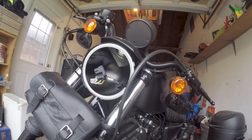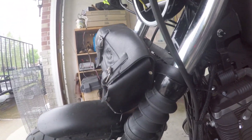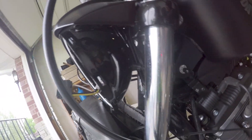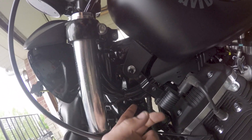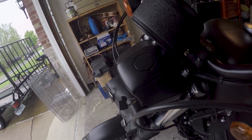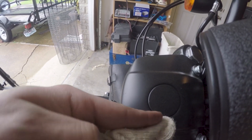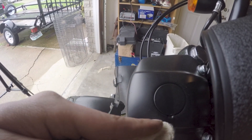Now with all that disconnected, you could just pop in a new headlight if that's what you wanted to do. But for me, I've got this bezel piece that I'm going to try to put on, so I need to do a little bit more than that. I need to follow these wires here, take my headlight off and disconnect the wires from wherever they go. Usually I'd use a paper towel but I couldn't find any, so I'm just going to use this glove over a flathead screwdriver to pop this cover off. Try not to scratch it. Oh, that makes me nervous.